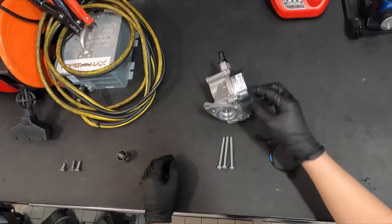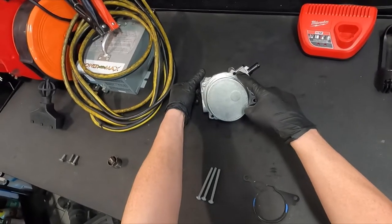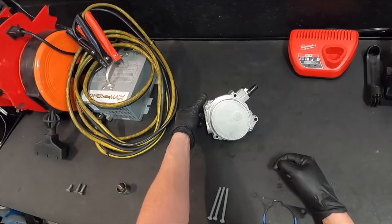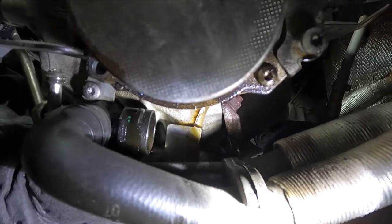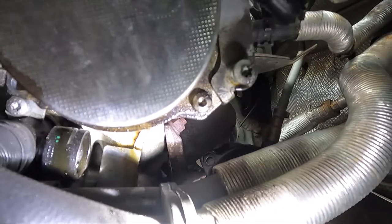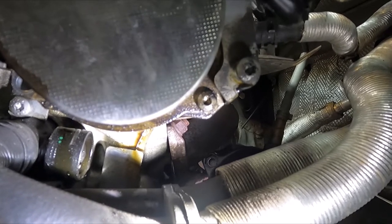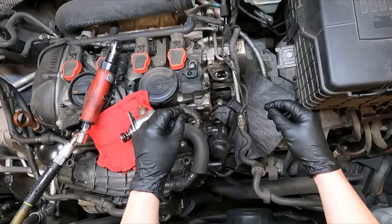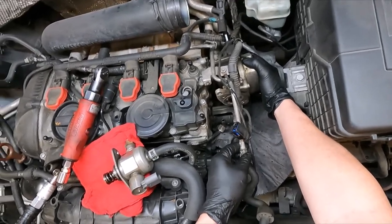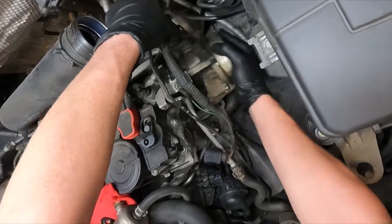The last step is to remove these three bolts for the vacuum pump. It's kind of hard to show it in the car, but it sits like that — if I turn it to the side I'll show you where they're at. There's one, two, three — go ahead and remove those. Looking directly at the vacuum pump, you've got a bolt right here, a bolt up top, and in the bottom back there's a bolt that actually holds this bracket. It goes through the bracket and then through the vacuum pump, so don't mix it up when going back on. Once you have all three bolts out, lift up a little bit on this hard line and pull the vacuum pump out. You might have to work it around the bracket.